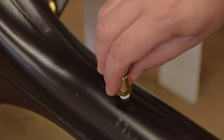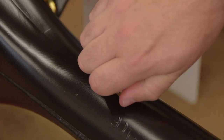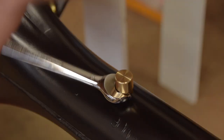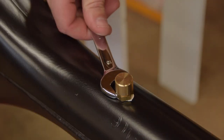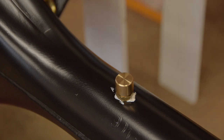The third bunghole to be bunged is the breather hole. It takes a little ball valve. The valve is supposed to let pressure out, but stop water coming in. They can be a little unreliable. If the valve is stuck closed, pressure will still force its way out, just through the oil seals instead.